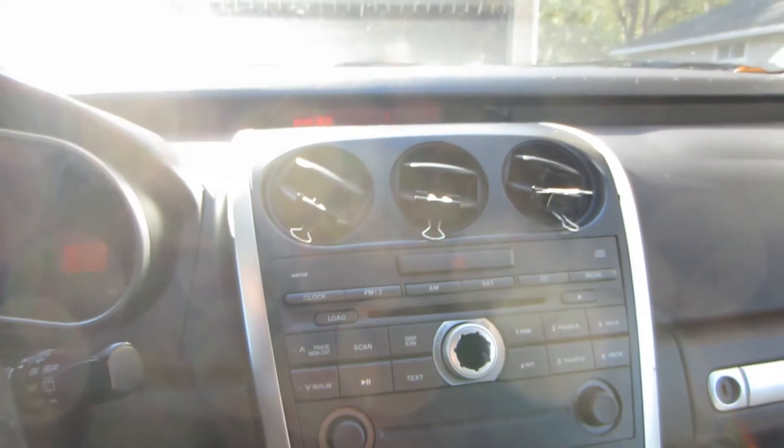It's actually pretty easy to get to this. I removed the radio bezel — just pry up from the bottom and then work your way to the top. This unit here is called the information center; it contains the passenger airbag deactivation lamp. It's held in with three screws which I've already removed. Side note: the light is no longer coming on and the airbag light is going to start flashing again — intermittent problem. To get this out you just need to pop it out like so, and I'll need two hands to unplug it, but we'll disconnect it, bring it inside, and see what's going on.